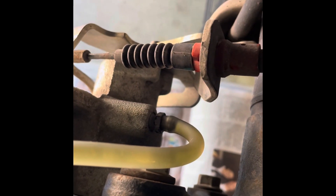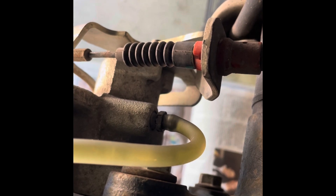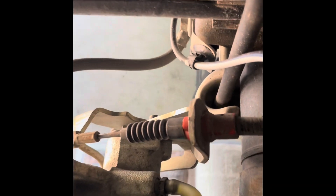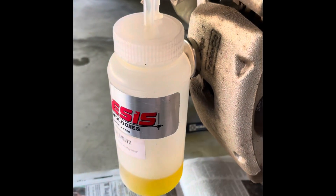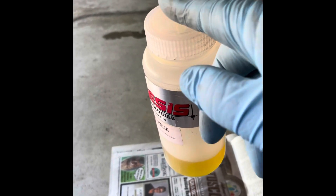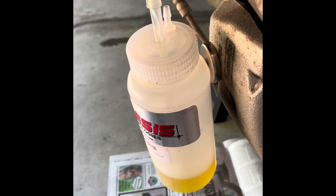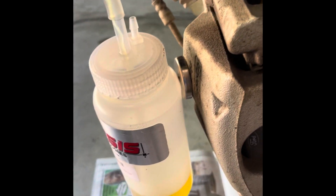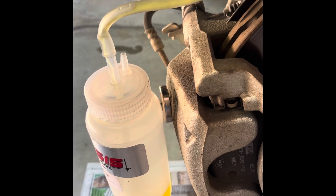The next step is behind the wheel on the brake caliper — you can see there's a drain. I opened that with a 7/16 inch wrench, which is an 11 millimeter equivalent. I had to remove a small black rubber cover from the end of that, using a small screwdriver to pry it off. Loosen it just a little bit, then put the hose on for this device — I really like it, got it for $15 on Amazon. It's a one-man brake bleeder. I put some fluid in the bottom of it already, using what I had drained off the top of the reservoir.